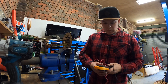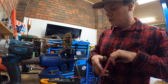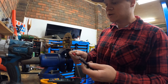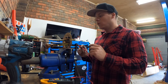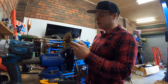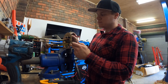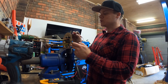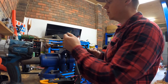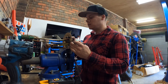Alright boys, got those posts fitted. What I'm going to do is set the multimeter — I've just got an amp clamp here, it's a multimeter and an amp clamp — and I'm going to do a continuity test. Basically what it is, it tests circuits. You touch the two prongs together, it completes a circuit, and then it does an audible beep. I'm going to test between the hat and the post, or the sender unit. This way we know that our all-thread, or our post, isn't making contact with the hat and causing either fuse popping or explosions. Life's good.